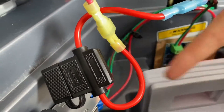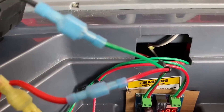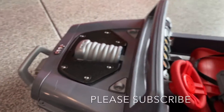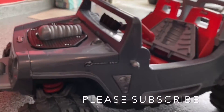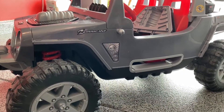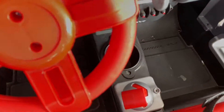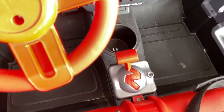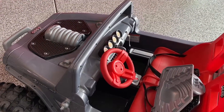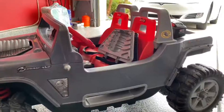So that's the wiring: in from the battery to the fuse, out to the DC speed controller, then directly to the original power wheel wiring. This thing is definitely much quicker — I've recorded it on GPS at about seven, maybe a little over seven miles per hour. It's got three speeds: reverse, speed one forward at about five miles per hour at 18 volts, and speed two at a little over seven miles per hour.